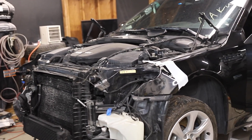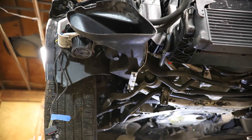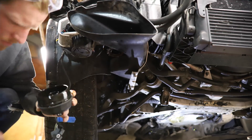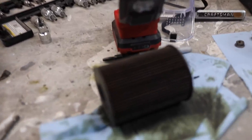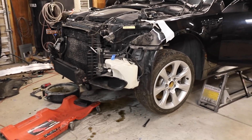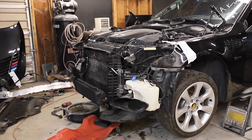Next thing I've got to do is go ahead and fill up the oil — no oil filter yet. So we got the old filter out and I went through every vein of the filter and did my best to inspect it and see what different things I could find in there. What I found was some of this stuff right here — these tiny little specks. They look like chunks of paint to me, but Brett was saying they could be chunks of copper, and it's really hard to test because it's not magnetic, so you can't just stick a magnet to it. That could be a sign that we're having lower rod bearing failure.